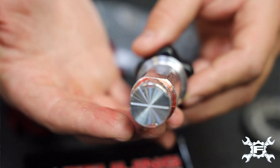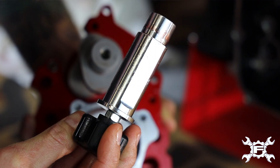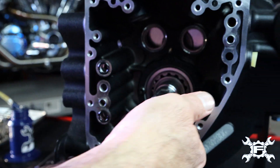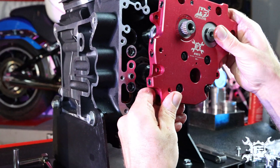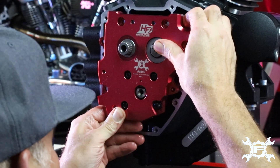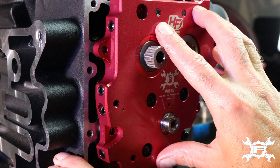We're already starting to pump some oil, or have some oil leak out. This should be a good match to the engine case. Plug, O-ring on the back of the pump, O-rings on the engine case, flats are lined up. Now we're ready to take our complete assembly and push it into the cam chest. You can use your thumb or finger to push on the oil pump to help pop that scavenge port into place.